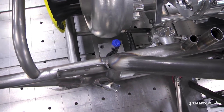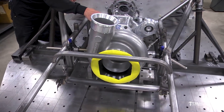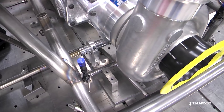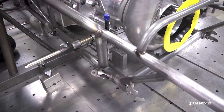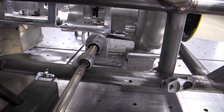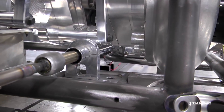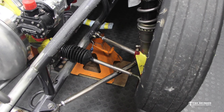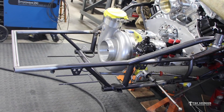The rack had to be moved back so it wasn't in the way when pulling the engine out. Now all this stuff unbolts really easily, so you don't have a lot hanging on it when you pull the engine out. But if you're going to do this on an existing car, you're going to have to deal with the rack — that's the biggest pain in the ass of the whole thing, trying to get it finagled underneath there. There ain't a whole lot of room; that thing just barely slides underneath that mounting system. Instead of the tie rod tubes angling back to the steering arm, they're almost going to be straight in line, which is not a problem — it works perfectly that way. Basically you have to strip this thing down to the bare frame rails and start over.